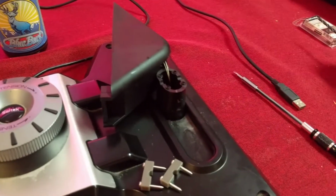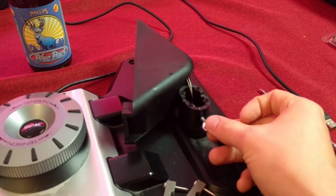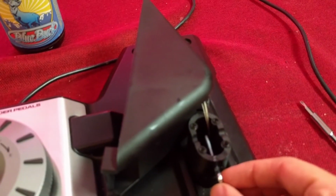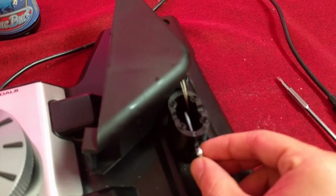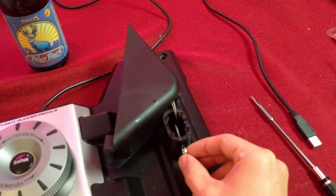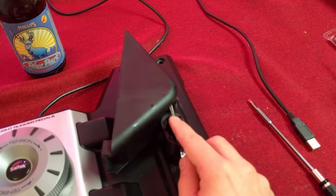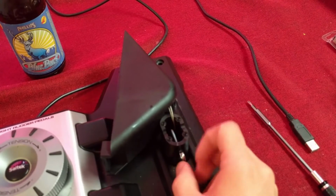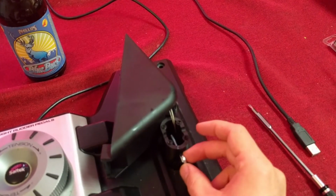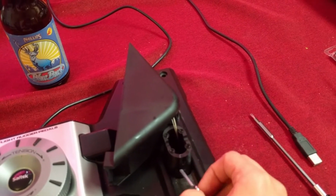Alright, now let's try out the bolt. The bolt actually sits very well with a 5/32. However, as you can see, it's gonna be a little long. So what I'm gonna do is trim that bolt up and make sure it's not too long and not interfering with these little cables and the other plastic parts that can be in there. So I'm gonna cut those bolts to length now, and I'll probably keep about half the length.